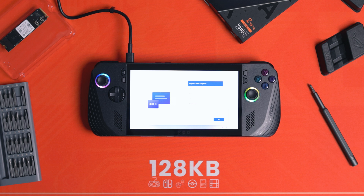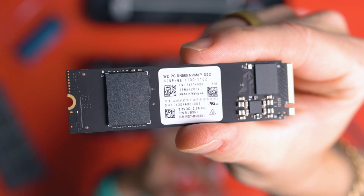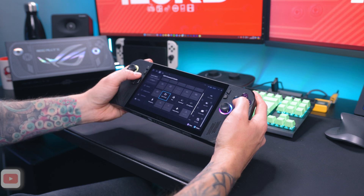Now skipping ahead — I'm checking the drive speed. The original Ally's drive in the pre-production model had a read speed of about 4,500 MB/s and a write speed of about 3,500 MB/s. With the WD Black SN850X we're seeing just under 7,000 MB/s read and 7,000 MB/s write — easily double the speed. I've now got a 2 TB drive and it's pretty much time to start installing things. Make sure you like this video, subscribe, become a member, and join me and AJ in the Discord — and subscribe to the podcast channel as well.